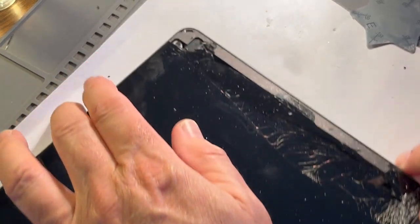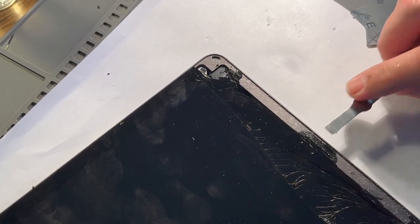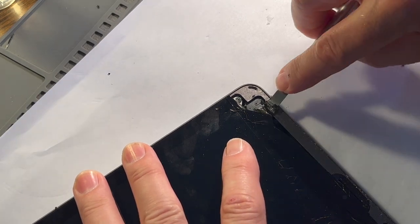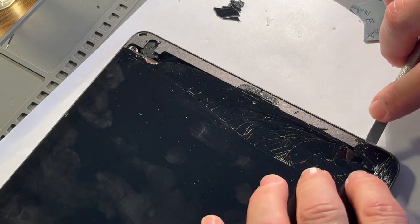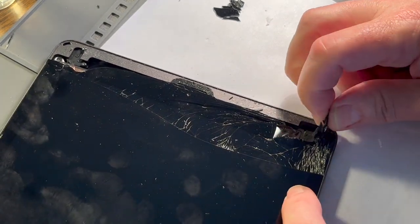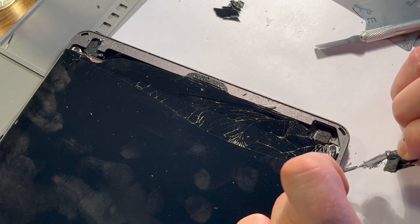I wanted to point out a couple of things. On these corners — this is the top corner, here's the camera — there's a little bracket right here underneath. So you want to be careful of this lens and not stick any tool in there. There are little square areas of adhesive right here — this is a good time to use the exacto blade. That little square is all covered in adhesive. And then you have that again over here, and you also have your rear camera right here — the back of the rear camera is adhered to the glass. So you want to be really careful in this corner too.